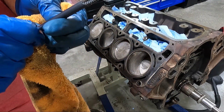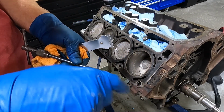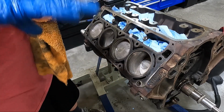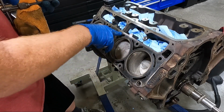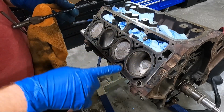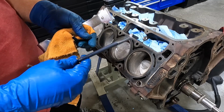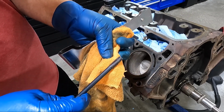But what I do is, see all that junk on there, vacuum this off, maybe spray it off with brake clean, vacuum that out, chase it again. I generally do it 3 times on each of these holes. The top ones I generally only go over once or twice, but that's kind of the method. Look, I tell you what, let's wipe that. Look how much came out.